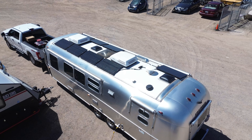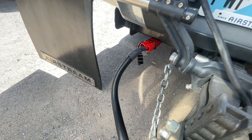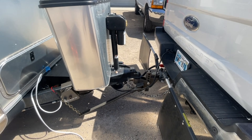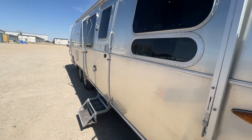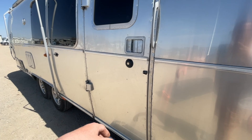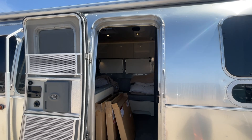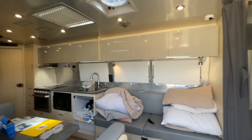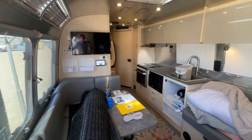On the roof this Airstream has 800 watts of solar panels that are securely fastened, as well as 600 watts of portable panels that allow the batteries to recharge in the low Alaskan light. We also did the DC-to-DC charger, which is a product that allows the truck alternator to charge the batteries so that you can arrive at your destination with 100% batteries topped off. A lot of solar designers will not include a DC-to-DC charger in their designs, when in fact it allows you to have an emergency backup — especially in this case with low light that would make charging your batteries difficult.